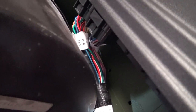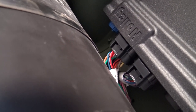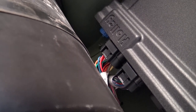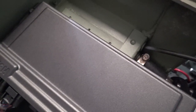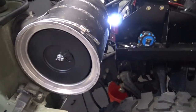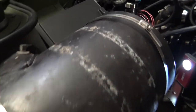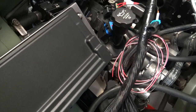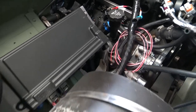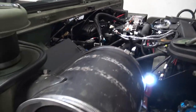So it's only those two connectors — the main engine harness and then probably one more for the transmission. The rest will be dead plugs. Back here that little blue thing is for the USB cable for programming, so that hopefully won't be unplugged unless that's what powers my dash. We can also run some wires up here. I'm really happy with it — when you sit right here you can't even tell it's there. You have to come up and look over to notice the Dominator. I'm going to disassemble everything, work on the heater hoses — for maintenance that's going to be horrible — then paint the mount, and start working on getting this huge wiring harness on the computer.